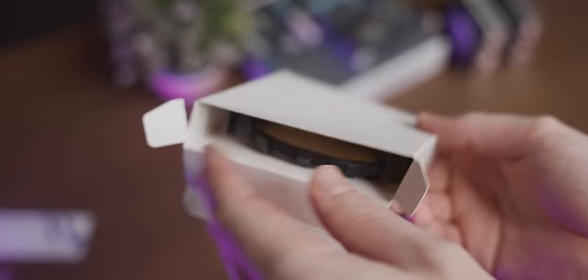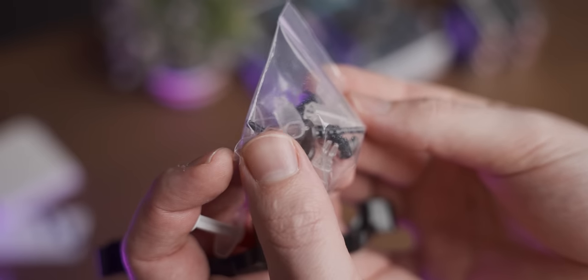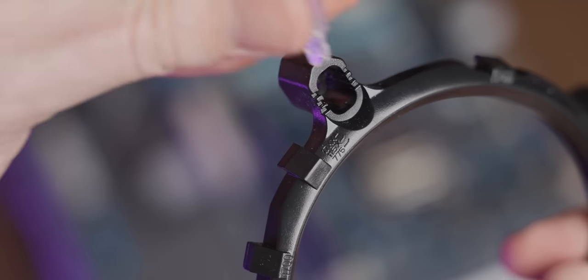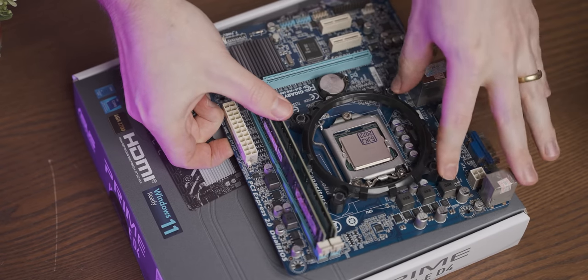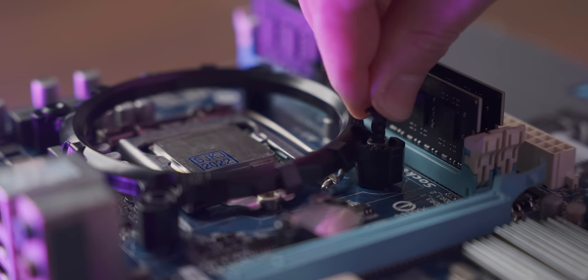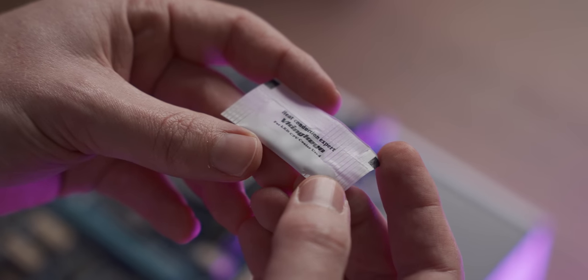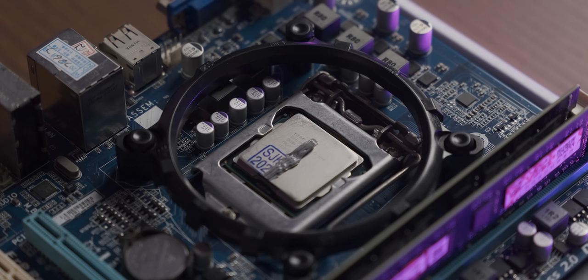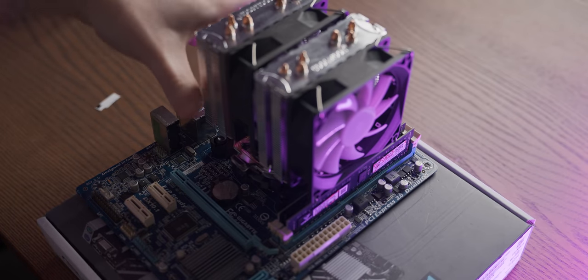That's not very much mounting hardware. It almost seems like some variation of a stock Intel cooler mounting plastic clip MacGyver. The little bracket tells you which notch to slip the little plastic thingy in — I think we need to do the middle notch. In terms of thermal paste, I'm going to use the very kindly supplied sachet of thermal paste. Squeeze that out onto there — wow, that is a lot of thermal paste. And then the cooler should go on quite straightforward. That felt very much like I was destroying the earth.